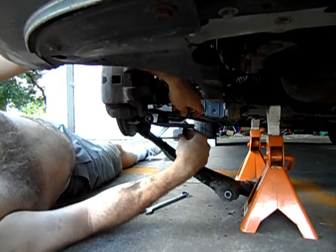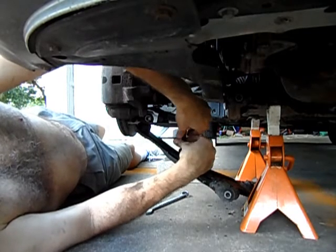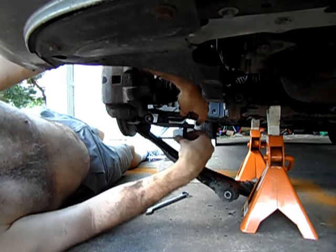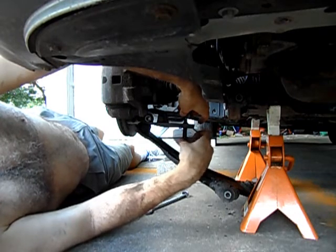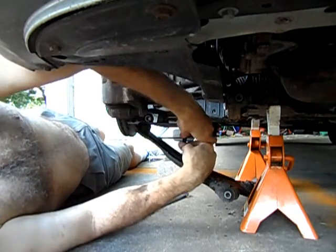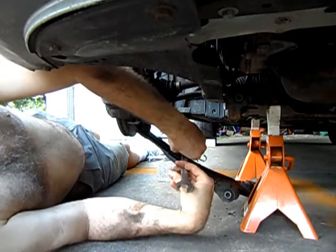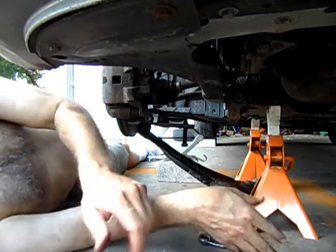Now the pressure by itself isn't what will drive the ball joint out. I'll need to tap on the, why are we not going in? There we go. So I'm going to apply a reasonable amount of pressure, not too light. I'm not trying to use just the screw pressure to release the ball joint. What I'm trying to do is apply pressure, and with the pressure constantly applied, see, I've applied some pressure now, and then I'm going to take, oops,